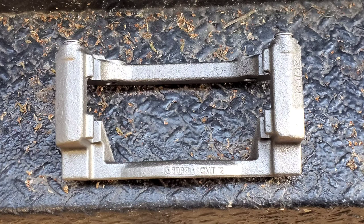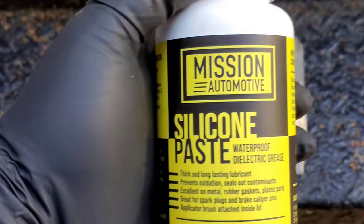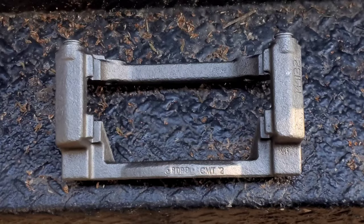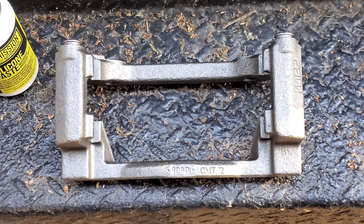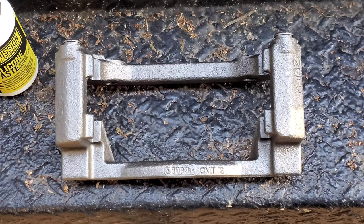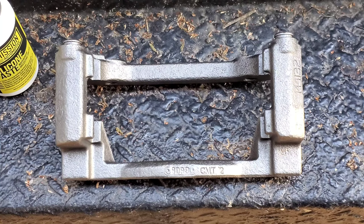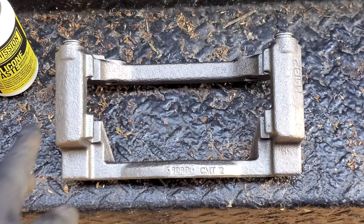It's this silicone paste from Mission Automotive. I'll make sure to put a link in the description for this if you guys don't have it. This is really helpful, because if you put any other type of grease, any grease that's not silicone or silicone paste, eventually it's going to eat up and mess up the boots that you are working really hard to put on brand new. You really don't want to mess it up and have it leaking the grease that you already put in there. And all of a sudden, it gets so hot, it could actually weld itself inside of here, okay? And you don't want that to happen.